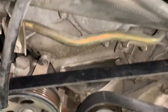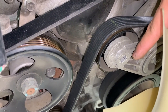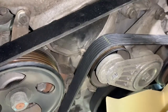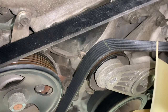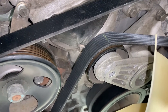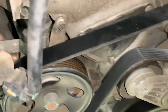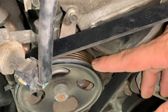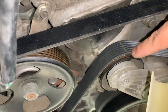Now that we've got some room, I'm going to give you a quick tour real fast. Down in here, behind the fan, this is where you stick your socket wrench to take the tension off the belt. It's really easy — you just insert it in there just like a socket, and you turn it to the left, lefty-loosey, and what that does is it pushes this pulley down, which takes tension off the belt so you can pull the old belt off. When you put the new belt on, just put it all back. If you forgot, do a quick Google search for the drive belt diagram for your Xterra — the grooved part of the belt goes on the grooved pulleys, and the smooth part goes on the smooth ones.